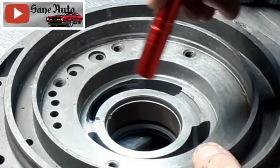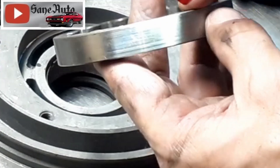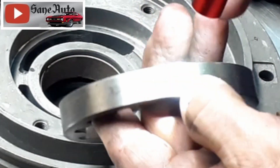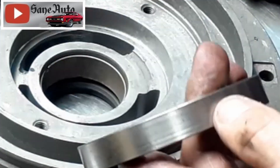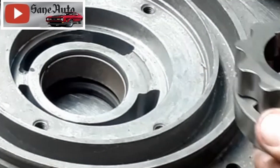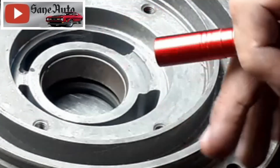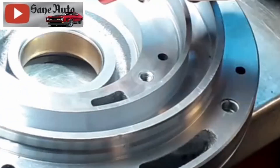You still can't reuse these gears — look at the state of them. The outer edge of these gears took most of the damage, and if you were to put these gears back in any one of these pumps, they would continue to chew up that pump. There's a little bit of damage there and a lot of damage on the pump gears, so these need to go in the garbage. Put a brand new set of pump gears in, scotch brite the body so it doesn't ruin the new gears, and you could have a decent pump out of it.